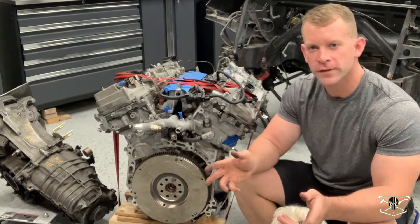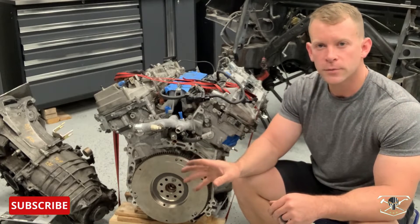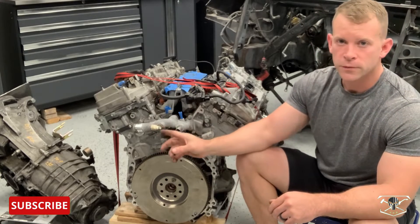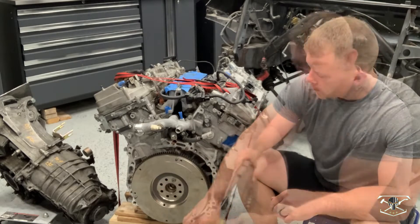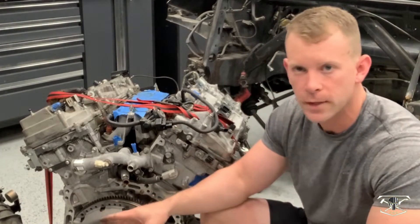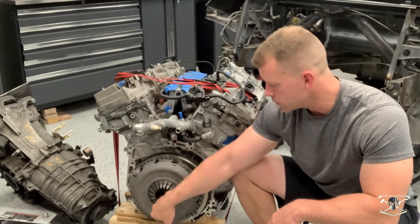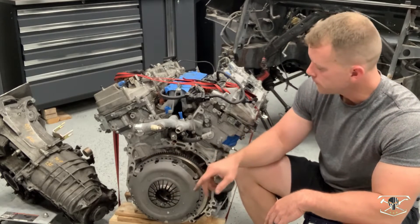Let's discuss all the reasons why this engine is going to be difficult to put in this vehicle. Number one: we do not want to install this engine transverse like a front-wheel drive car, so we're going to be using that Porsche transaxle. The thing is, that transaxle requires a Porsche clutch as well as a flywheel that will accept it. This is a Toyota flywheel, and when we put a Porsche clutch up to it the overall dimensions are there, however it doesn't bolt up. We could take this to a machine shop and change the bolt pattern so it fits, but our next problem is there's no place to put the actual pilot bearing that accepts the Porsche transaxle.